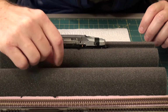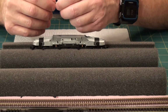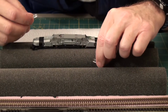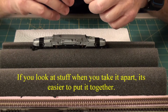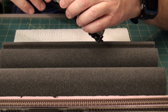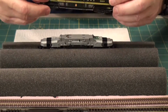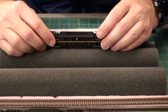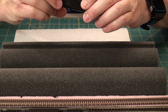Now the only light pipe you need is the forward one. Which was this guy. I think. No, that doesn't make sense. Let's try this one. Yeah, this one slides in better. Because it says the rear one isn't needed anymore. And this one, yeah, that slides in. That's forward, that's forward. Let's double check here. Make sure that lines up and that line, everything seems to line up. So let's gently position this. And it all lines up.